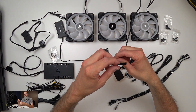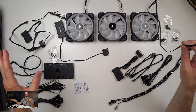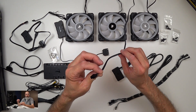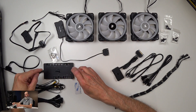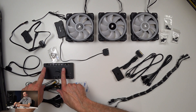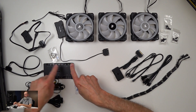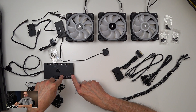You still have to plug these into your motherboard, so I'm thinking I might add one or two additional fans. As you can see, this always adds some challenges to cable management. So what I finally decided was to get these off of the motherboard and move the cable management to the rear of the PC where you couldn't see it. I chose to go with the Commander Pro — essentially a fan hub, but it rolls multiple Corsair functions into one. You get six PWM or voltage-controlled fan connectors and two LED RGB channels.